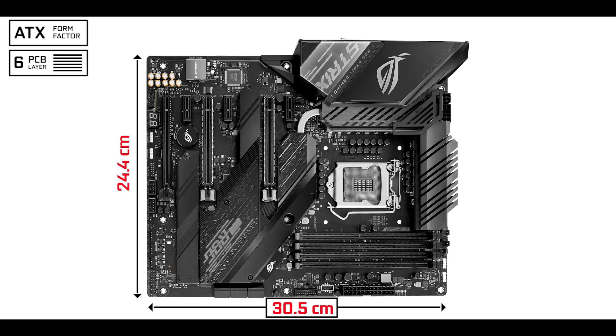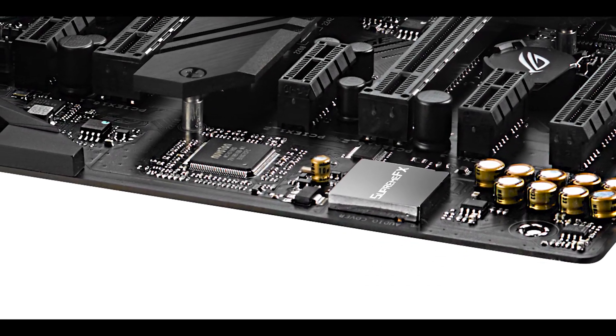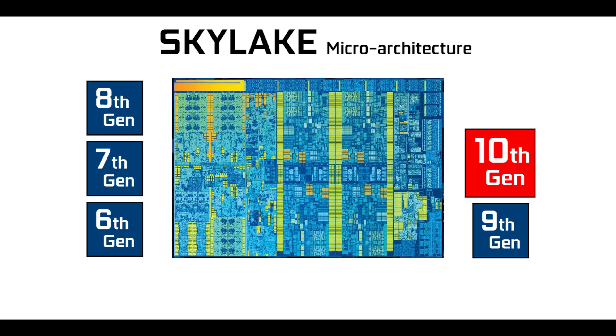The Strix Z490-E is a six-layered ATX motherboard — a significant upgrade from the Strix Z390 in PCB layers, which I was expecting given its PCIe 4.0 design. It better isolates signal interferences when running bandwidth-intensive tasks, giving us a more durable and stable overclocker. The more complex manufacturing process is where most of the premium you're paying is hiding. CPU socket-wise, we have the new LGA1200 socket, a 49-pin upgrade from LGA1151, meaning it is not backward compatible. Technologically, the 8th, 9th, and 10th generation Intel processors are all based on the same 14nm Skylake architecture, and since they are all PCIe 3, there is really not much need for a new socket — a point I'll be making again later.